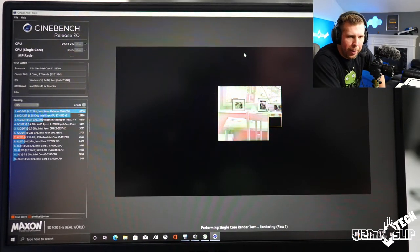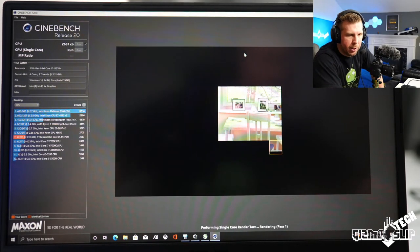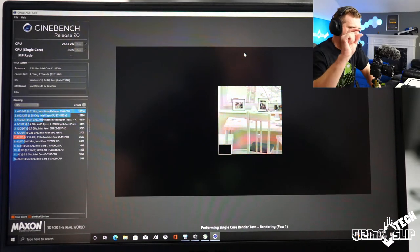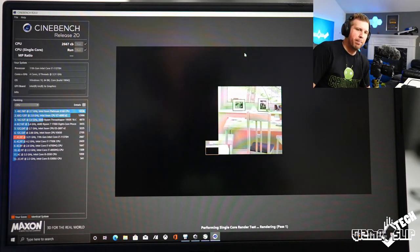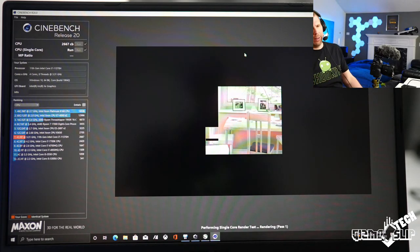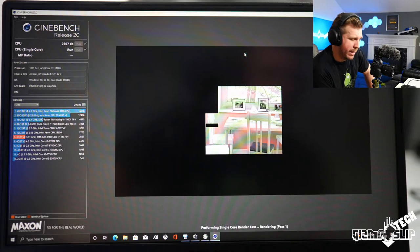So yeah. How much more battery would you get with the Ryzen 5000 versus Ryzen 4000? Not a huge difference in battery life, I don't think, Phantom Online, because they're both on 7-nanometer architecture. But it's probably just a slight difference. An increased battery overall size is going to make a bigger difference for how many watt hours the battery is in each laptop than if it was Ryzen 5000 versus 4000, I would think.